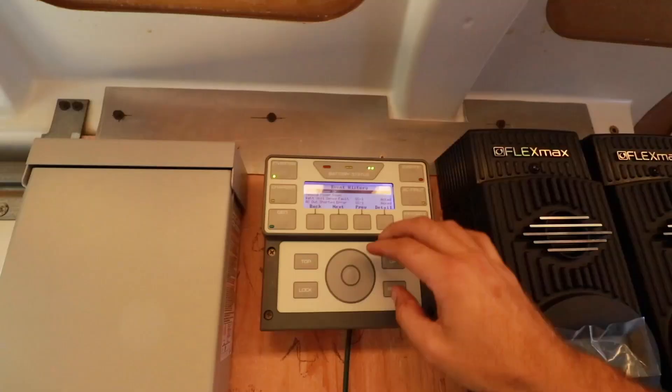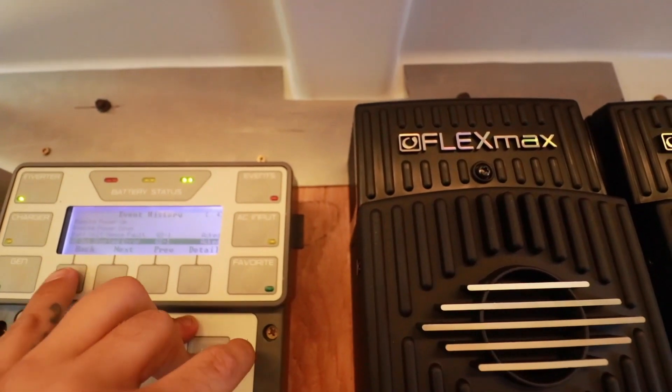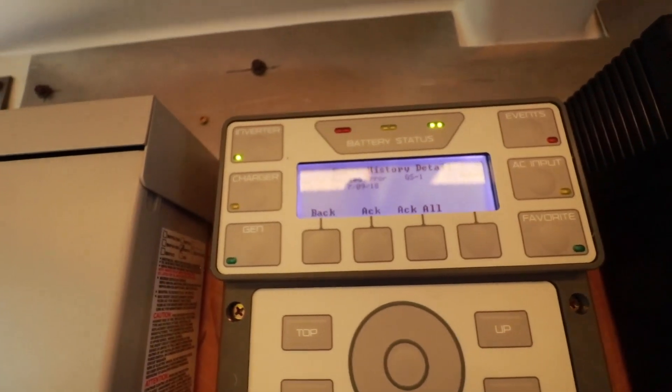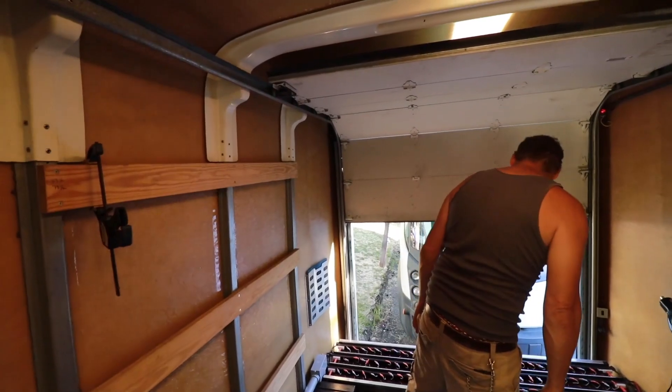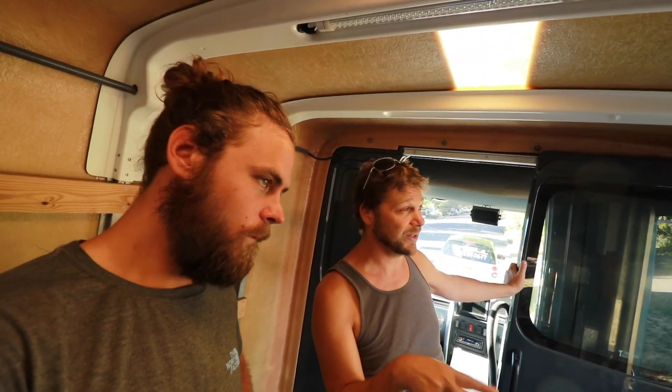Everything is firing up, which is good. Basically, I have my solar coming in and a secondary battery pack, just like yours. However, my EV charger can take DC — I can put either AC or DC into my battery charger and it's just on a breaker. If I should have my solar left on, it'll throw that breaker. But it sensed the battery. So Brett's just going to plug this thing in and we're going to see if it starts charging. Oh, there we go — it's working now. It's pulling for him. He's going to turn it up again. 49.6 volts still — 6.4 kilowatts is our major draw. Battery voltage is 49.2 still. We are charging an electric bus with my van.